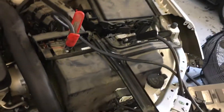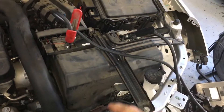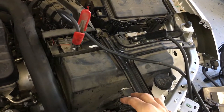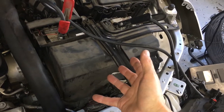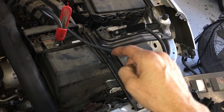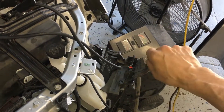This one had a dead battery like many shops. As customers, if you ever wonder why your batteries immediately die after you come from a body shop — it's because they cycle the batteries, leave doors and lights open, drain your battery, then put it on a massive quick charger because they want to get it started fast. And you already have like a four or five year old battery. They become fragile when they get old. They may have a couple more years of life, but if you drain a lead acid battery that's four, five, or six years old all the way down and hit it really fast with a quick charger at maximum amperage...